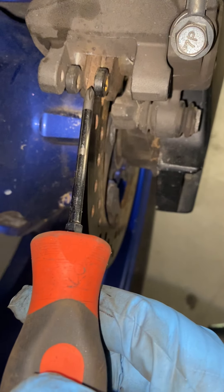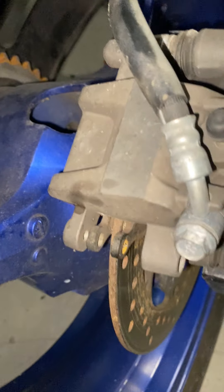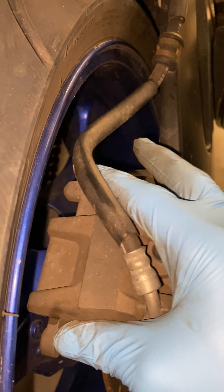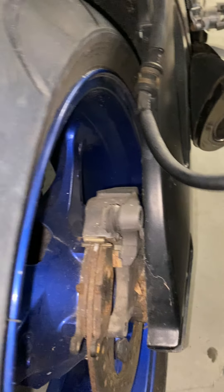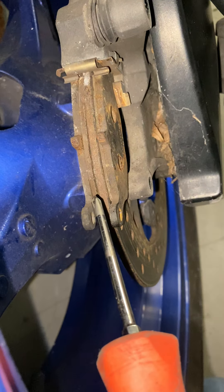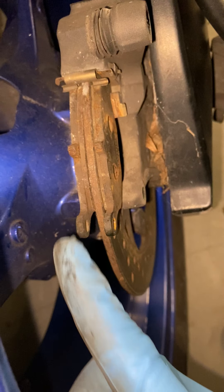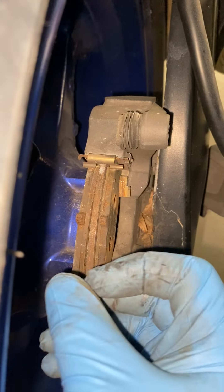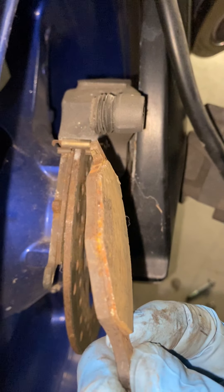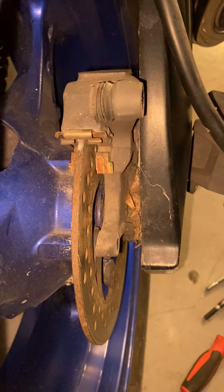Normally you could look and see if you need pads — you can see the thickness of the pads right here. But the best way honestly is to take it apart, because it's a motorcycle, two wheels, that's somebody's life. There's a little trick: you'll notice this side has way more thickness or material than this side. That's why it's important to take it apart and inspect it. Sometimes it happens on this side, so you may see one side and say you've got enough brakes, but these definitely need pads.